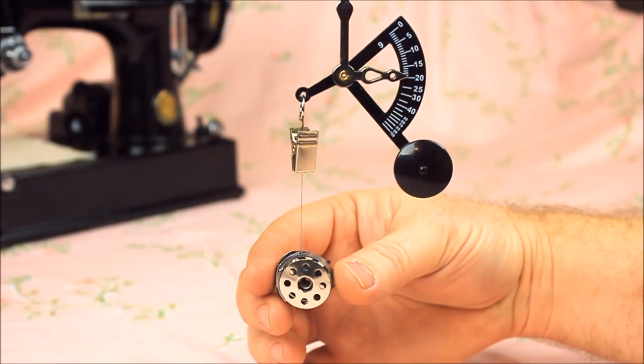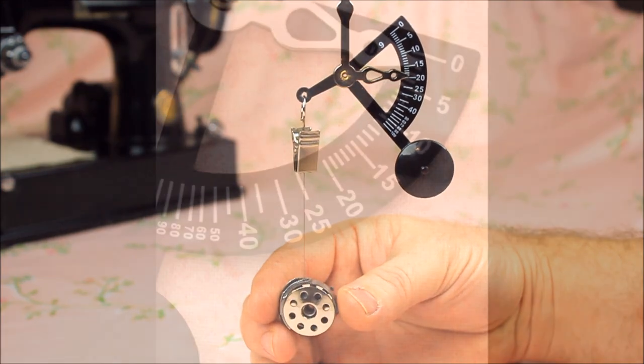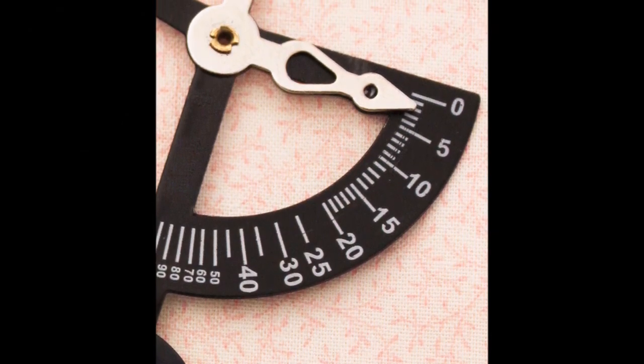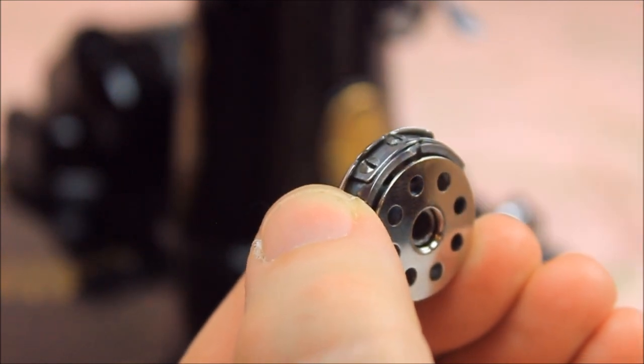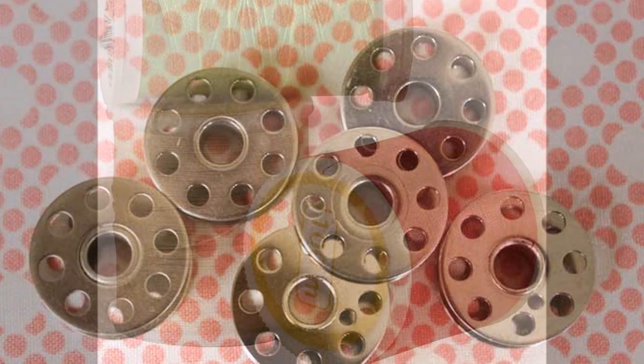As a point of troubleshooting, you may notice that while performing the test, the indicator needle may bounce and not stay on a steady number. However, this can be caused by a dirty bobbin case, lint under the tension spring, bobbins that are an incorrect size or are bent, and also lower quality threads.